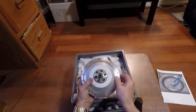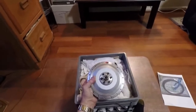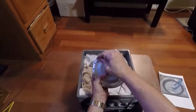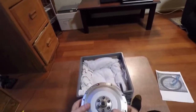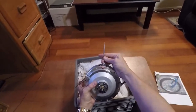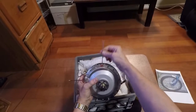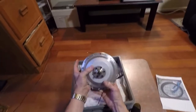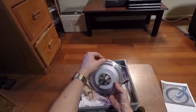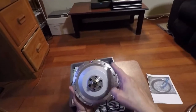We're going to take nine spokes and drop them in every other hole on the front flange. This spoke marked in red I'm going to arbitrarily name the key spoke — we'll be referencing it later as it goes through the red hole. Before moving to the next step, confirm that every other spoke hole is occupied; there are nine spoke holes occupied at the end of this step.